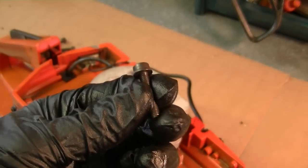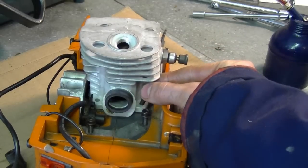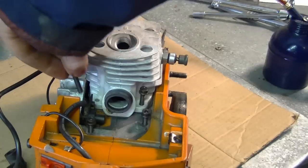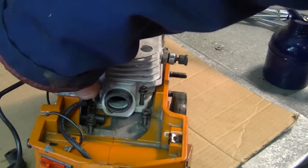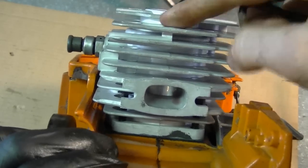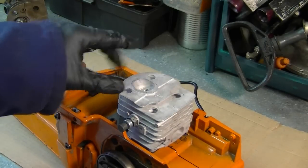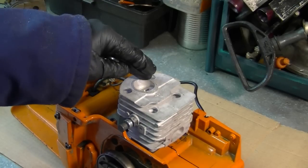The bolts that go on there are these allen bolts — there are four of them. Just insert them into the holes. At the back you can simply go behind and insert them in there. Now tighten them all up evenly. The way to tighten evenly is: tighten one up here, then here, then there, then there. Snug them all up and then go around and do the final tightening. The reason for tightening the cylinder evenly is to prevent air leaks. If your saw has a leak from the base gasket, it's not going to run properly because the air needed from the crankcase to power the carburetor will not be sufficient — it's going to be leaking out from the base of the cylinder.